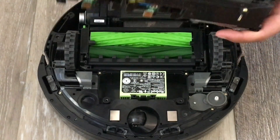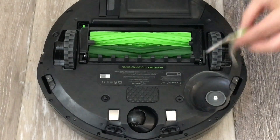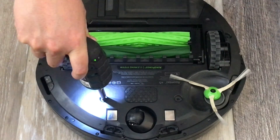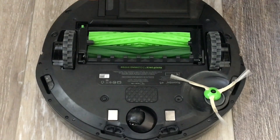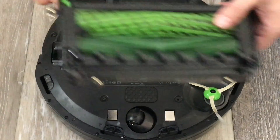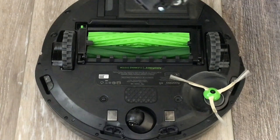If your unit's under warranty, in order to get to this, you're gonna have to contact iRobot customer support. They're gonna have you take off the back cover so they can send you a new one, because they just want to make sure nothing was constricting that motor. This is the motor they were talking about. The easy thing to try first is to just spin this a few times, see if it starts working, see if there's any dust blocking it. In my case it wasn't — I guess it was just the motor that failed.